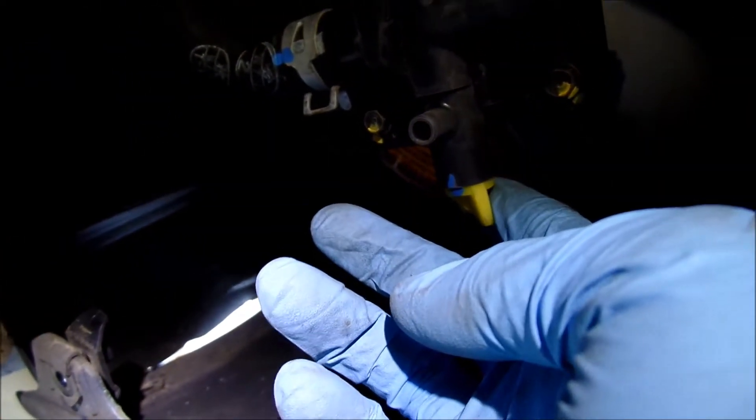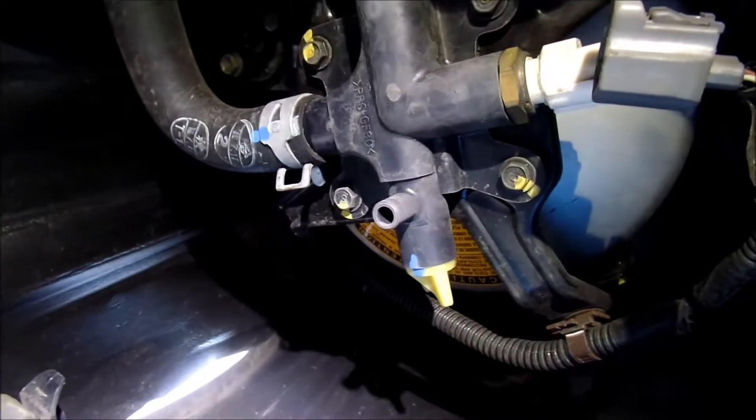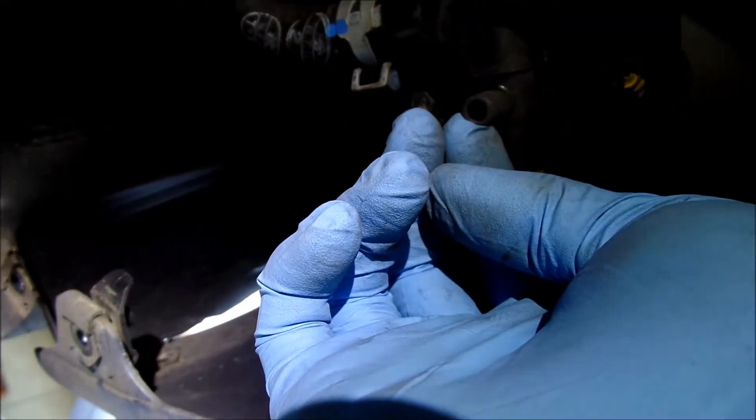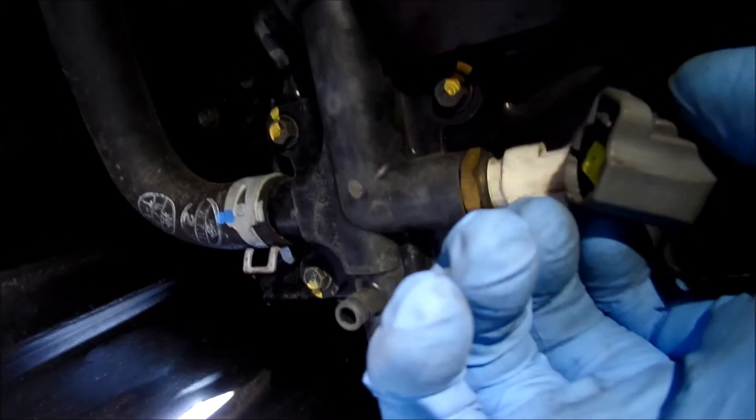I've gone ahead and taken the panel off. You only need to take a couple of panels off — this one and this one and there's another one over here — and that gives you access to the thermos canister where all the hot coolant is pumped into after you turn the car off. I think that's a pretty cool device to have on a car, brilliant actually. This is the drain fitting here, and this is where you're supposed to drain the thermos. You're supposed to disconnect this electrical connector here first.